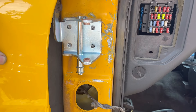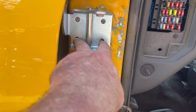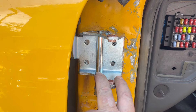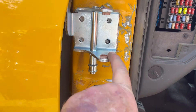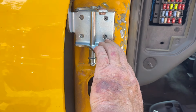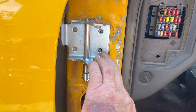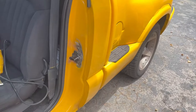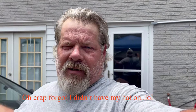I got the old one off and the new one in place. I'm trying to line it up with my marks. I was going to drill holes and bolt it in, but I think I'm going to go ahead and weld it back in like the factory. I'll put a couple little tacks in, set the door back in place to make sure it lines up, and once I confirm alignment I'll weld everything in. The hinge is welded back in place past the area where it was cracked.